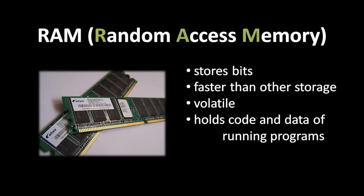We also make a tradeoff with RAM between speed and capacity, and also speed and cost. Per gigabyte, RAM is much more expensive than other mediums like hard drives. Whereas here in 2010, $100 will buy you about a terabyte of hard drive space, it'll only buy you about 4 gigabytes of RAM. So the typical PC sold today has between 2 and 8 gigabytes of RAM.